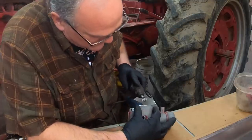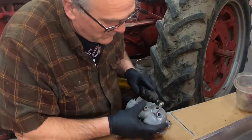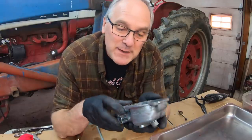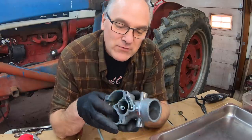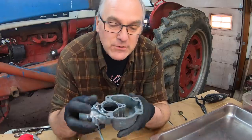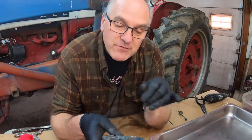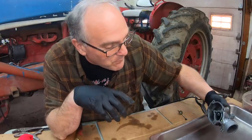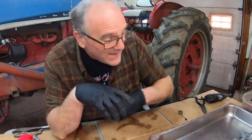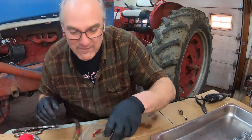I like to be really conscientious about this part — I want everything to be nice, clean, and spotless, even if it takes multiple steps. This is aluminum, so it's just a light touch with a steel brush to take the paint flakes off. Here's the fuel bowl, all bright and shiny and clean. My opinion is the devil's in the details with a carburetor — I spend more time on cleaning than any other step. So I've soaked it in carburetor cleaner, washed it off in water, blown it dry with the air hose, gone over it with the Dremel to remove stubborn dirt, and I'll spray it out with carburetor cleaner afterwards to get all the orifices and passageways clean. Having an ultrasonic cleaner doesn't do it all for you — you've still got to do the detail work to have a carburetor that works perfectly.